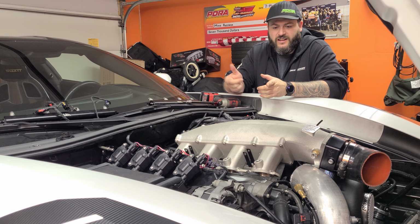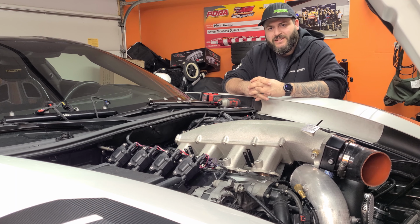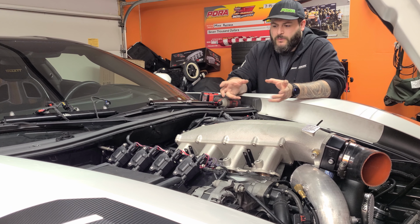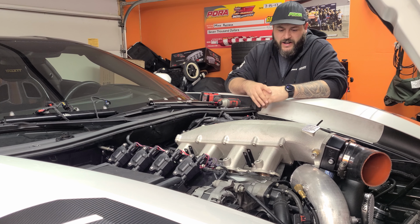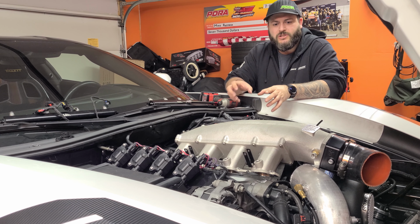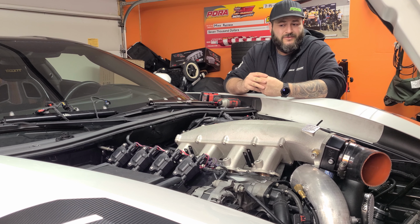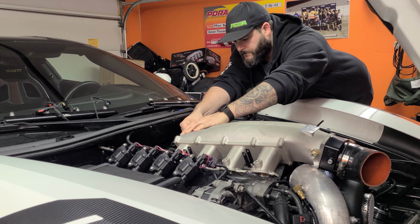Evacuation complete. While the antifreeze is still leaking, let's start pulling off some of the things on the top. We'll start by finishing the intake manifold, and then we'll get the coils off, two-step wiring off, we'll get the valve covers off, then we'll start pulling some valve train out. I'll have to take out the blower, and we'll see where it goes from there.